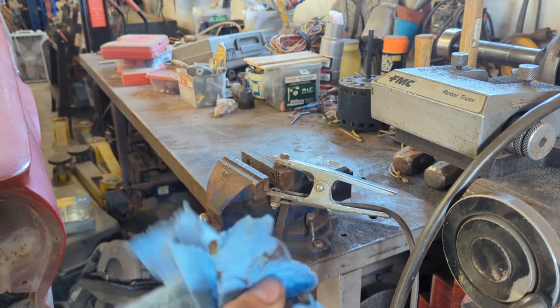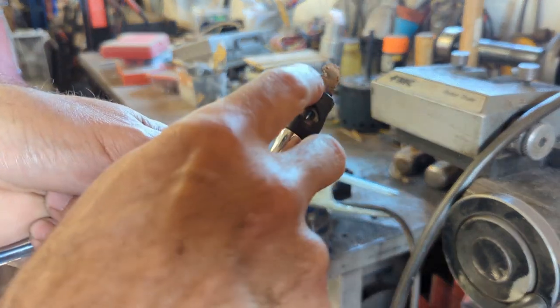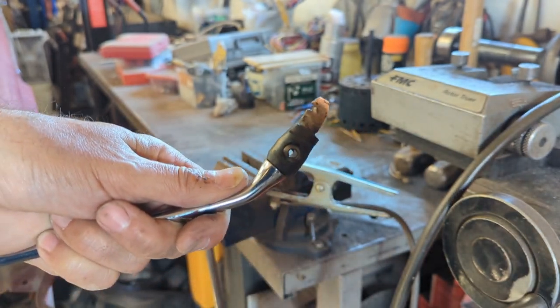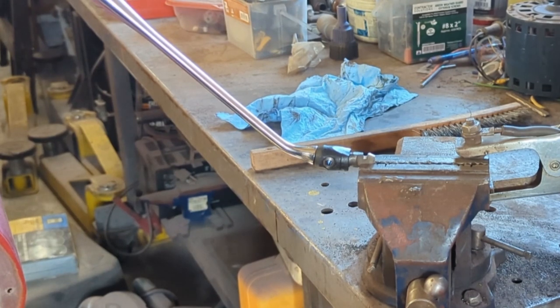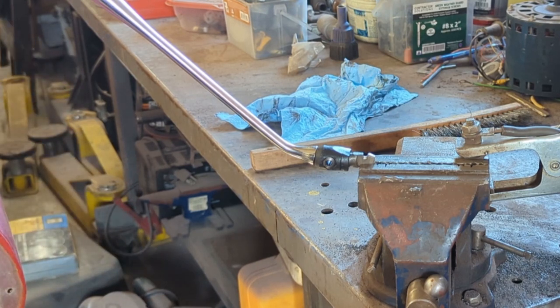I'm making a big trip back East in early July, so I wanted good brakes — new pads and redressed the rotors. Let me get this in the vise. I'll wire brush that area so we get a good connection with the weld. She's in the vise. It's just a few tack welds and I'm in tight quarters up near the front of the old convertible. I've got the welder turned on, using 0.023" wire, and I've got the welder cranked right up — I want to hit this hard and hot.